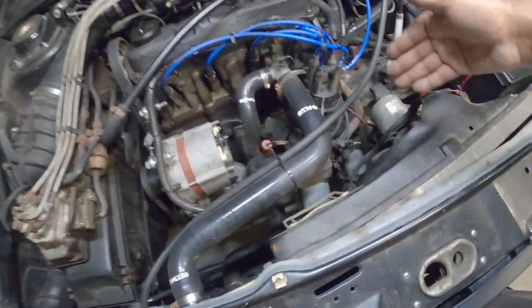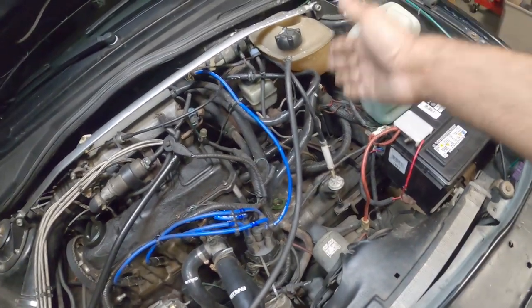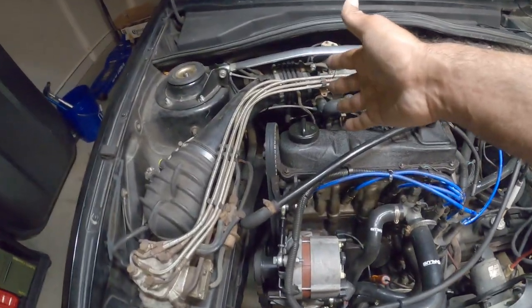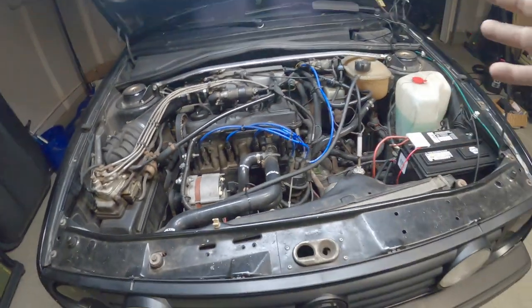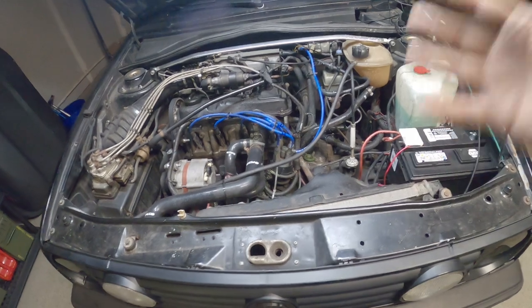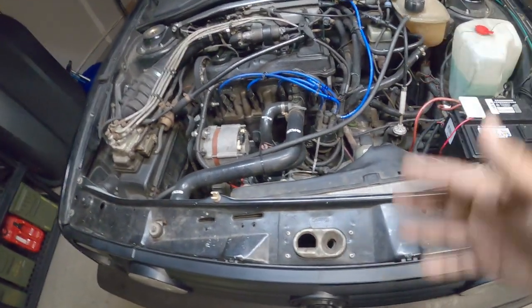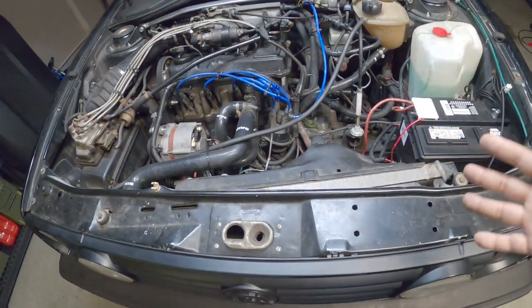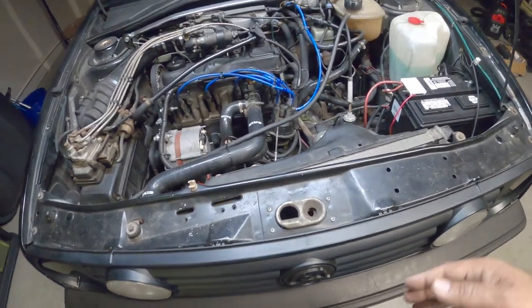When you get down to the front end, down low, the motor mounts, the transmission mounts, and the rear motor mount, more than likely, if you've never serviced it or it's been serviced and you don't remember the last time you serviced, you're probably gonna have to be ready to swap out new bushings. I would recommend it for a fresh removal and install. Once you remove it, it's super easy to get to. It's literally a couple bolts and you can swap everything out super quick.